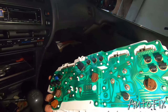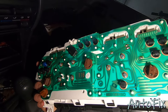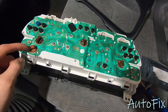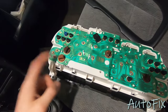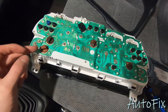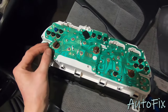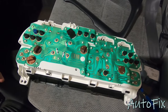Be very careful with this wiring board in the back. It's very thin plastic with copper strands going through it, so make sure you don't rip it, scratch it, or tear it in any way. The bulbs you're interested in are these dark brown ones — three of them. You don't want to replace this one with an LED because this is actually the bulb that indicates your low fuel. I did replace this with an LED one time and it turns out it will just stay on all the time. I'm not sure if it sends a low current — it'll only work with an incandescent bulb. Either way, I had to swap it back because it would always stay on.